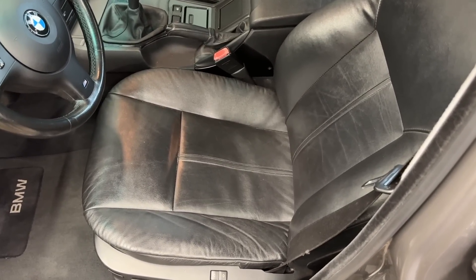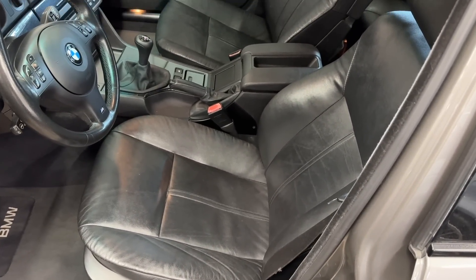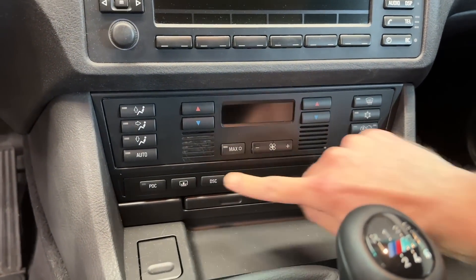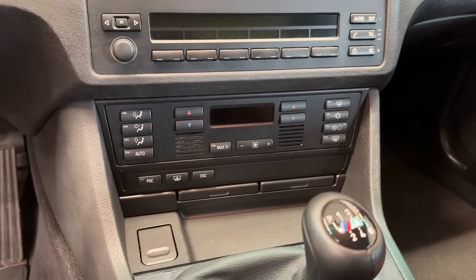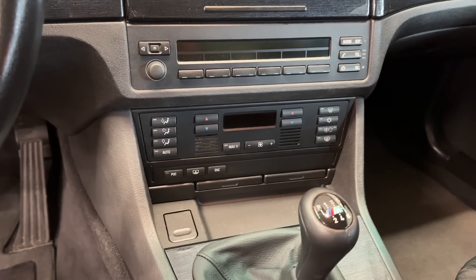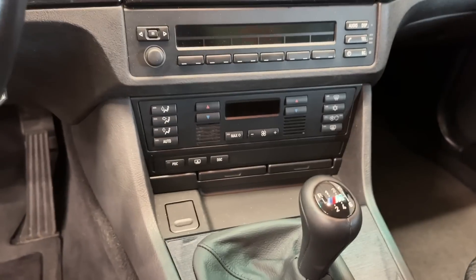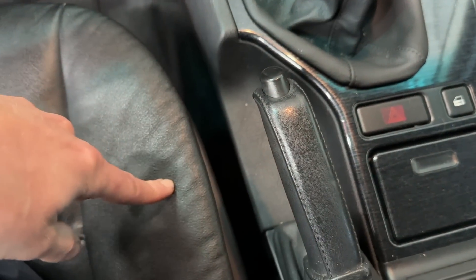We're not going to be tearing the seats down to replace anything underneath. The components we need: the seat itself if you'd rather buy a used seat versus adding heating panels; a center console switch panel (SCM) that retains your existing buttons and adds heated seat buttons — head to eBay and search for E39 center console switch. We also need a retrofit wiring harness, which is no longer available new. Thankfully there are people in Germany remanufacturing these using the same wire colors and pins — it's largely a plug-and-play harness.